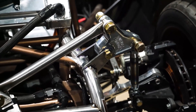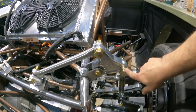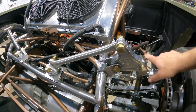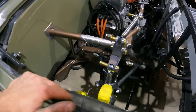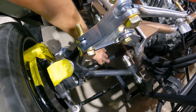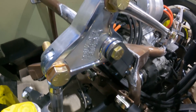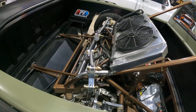Phase one of our push rod suspension is all set on our EVC 10 — and just look at it. The thing is low — way lower than it was at SEMA. In the back you can see there's no way you'd be able to fit a coilover that's only seven inches long. With this setup we're now able to have much shorter travel on the outside where the actual suspension is and put all of our coilover on the inside. Same with the front — with that all-wheel drive system and the half shafts everything was in the way, but now with the push rod setup it's just where it needs to be. Those billet rocker arms that JC made for us really knock it out of the park. Next time you see this truck we'll be throwing the coilovers on — it's going to bring a whole other element to the bed with the jungle gym appeal.